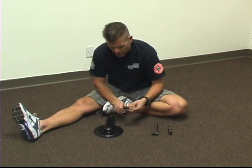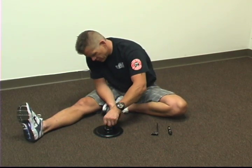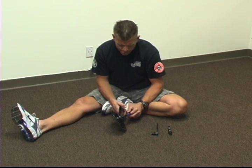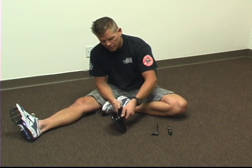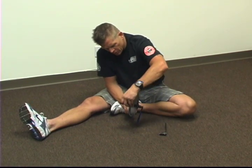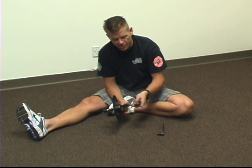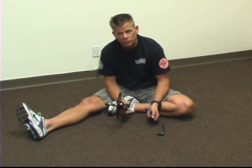And probably the most important dynamic to using a crank tool is making sure that the crank tool is screwed into the crank as far as possible. Typically, a lot of people using crank tools will only screw the tool into the crank arm a few turns, and then as they go to press the crank off of the spindle, they end up forcing the tool out of the crank arm, and it pulls the threads out of the crank arm. Then you're screwed, because you can't get your tool back into the crank arm to do the function that you started out to do.